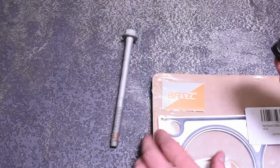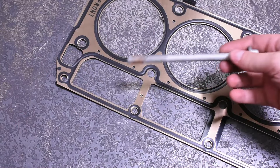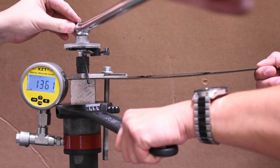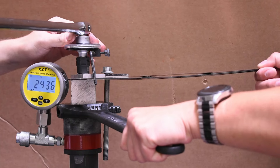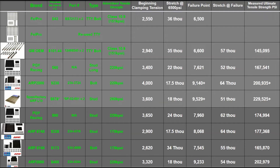Myth A: should we be testing with multi-layer gaskets? Typically we remove as many variables as possible, especially squishy ones, when testing bolt stretch. But point taken. Testing with another Felpro OEM-style TTY bolt from our large set with a head gasket, this settles to about 2,400 PSI — slightly less than the 2,550 we've seen before — but we'll let you judge whether this falls in a normal range.